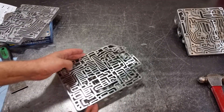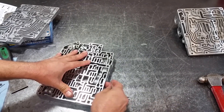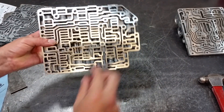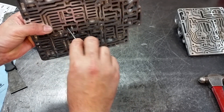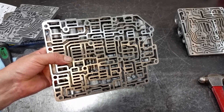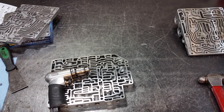Now let's go ahead and do our valves. We have our pressure regulator valve lined up right here. We're going to disassemble that — go ahead and take the clip off. We need to remove the pressure regulator valve because we're going to drill two holes through here, and we don't want any chips getting hung up between that valve and causing damage. Go ahead and remove this valve.